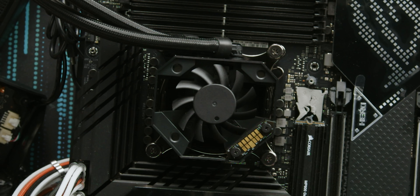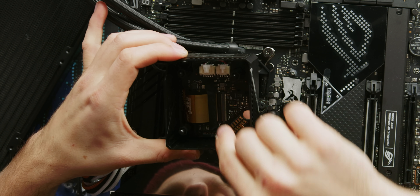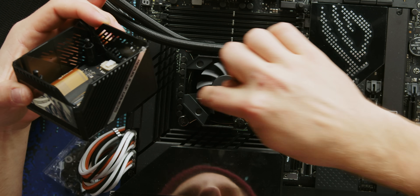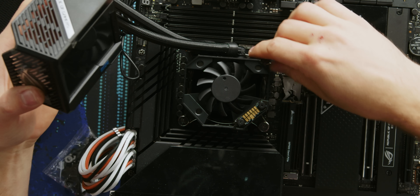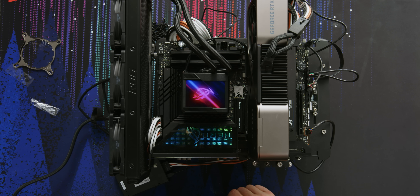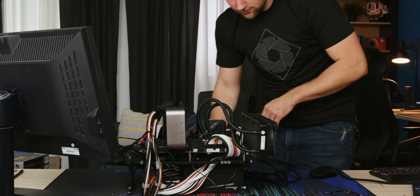Your instructions are useless, but inside here there's a big ribbon cable - there's gonna be a graphics driver on here, and this ribbon cable will feed the display. Some pins rest in these holes. This is what's gonna cool all these VRMs - airflow down through and around these heatsink fins to move heat away from the VRM. These are PWM fans so they're all individually controllable. It's a big display - three and a half inches is not tiny.